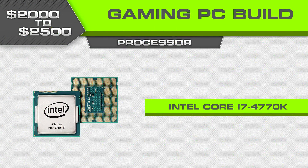I did the calculation for this particular build before the overclock and it looks like it's right around 625 watts. I try to go about 30 percent above what I estimate — which would be around another 180 watts — and since you're going to overclock you want a little room there, which is what I think you want.